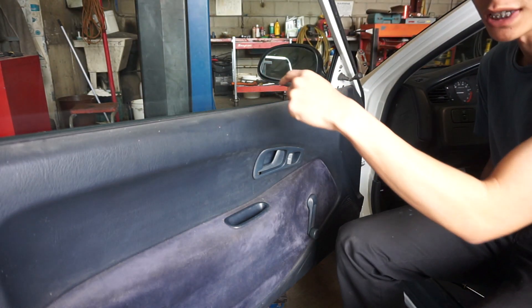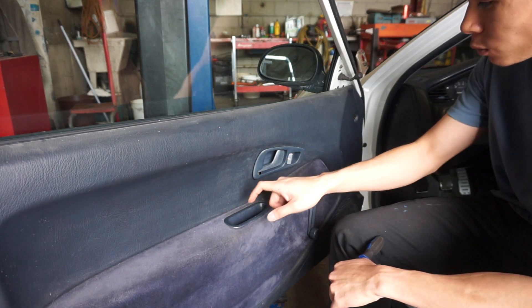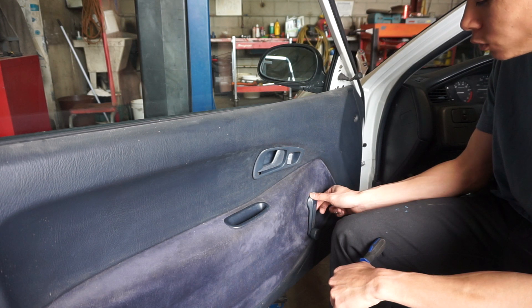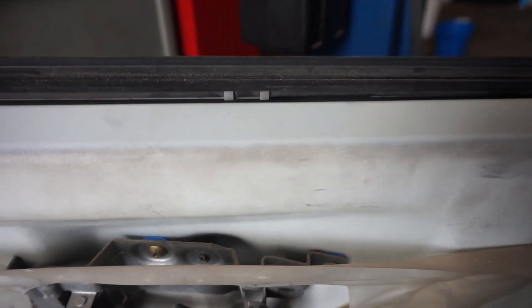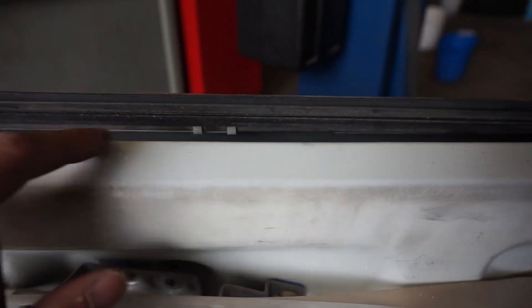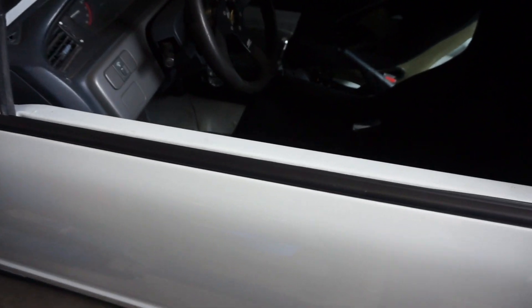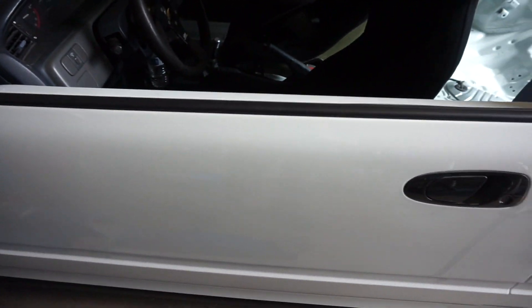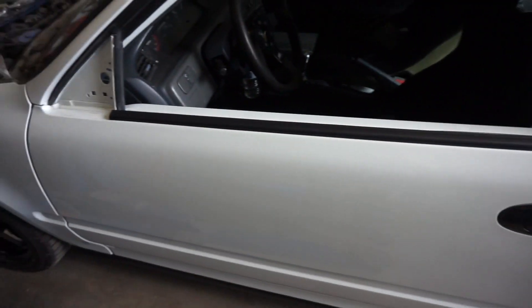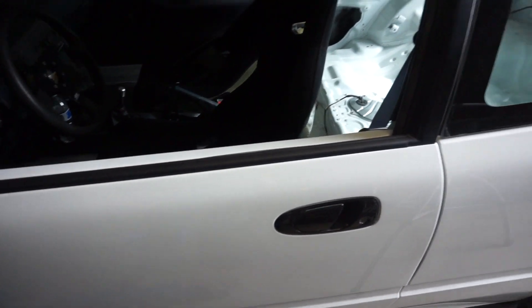To get to the trim piece on the outside that I want to change, you have to take out the door panel. There'll be a screw right here, one in the handle, a little clip behind the window roller, and then another screw right here. I've never actually taken out this trim before but it looks like it's just these four white clips. All I had to do was pull up on it and those four white clips popped out of the door. To put it back on you just push down on it, line it up with the holes, and it looks so much cleaner with the door trim and the door sashes.